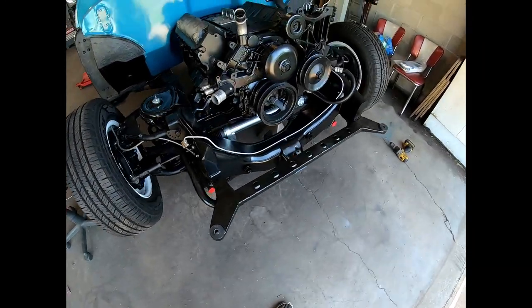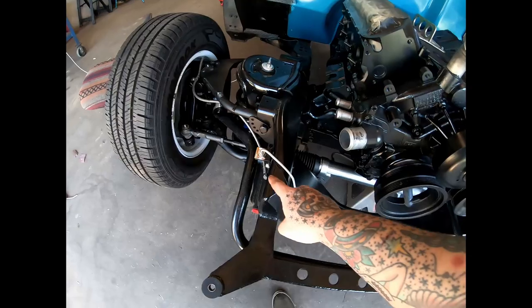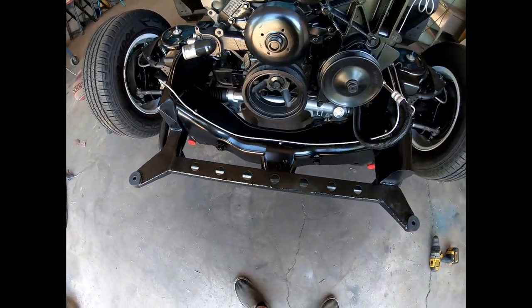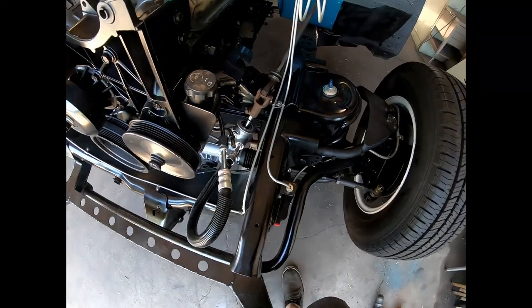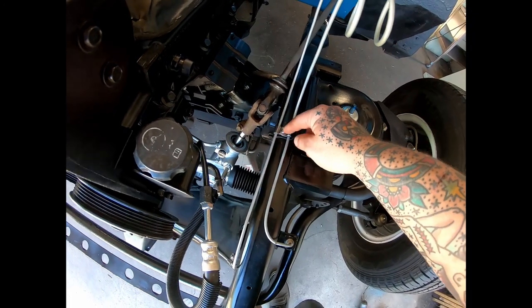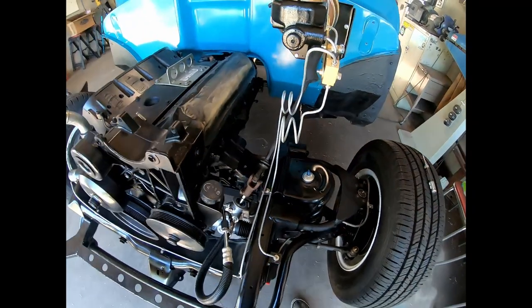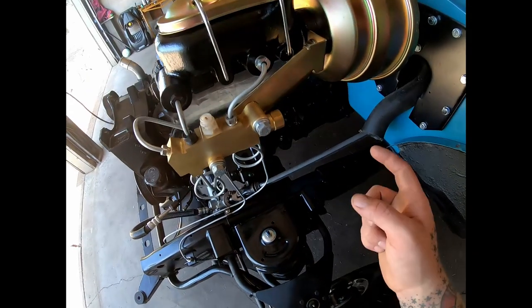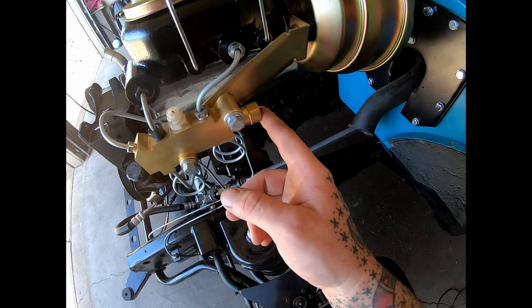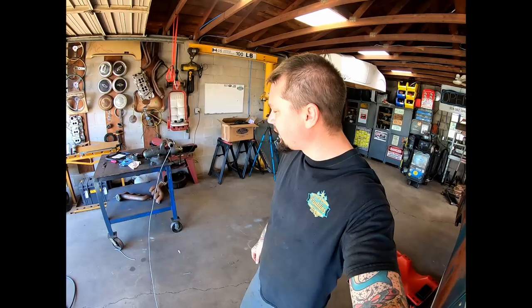Next morning now, and I got out here and I built the other brake line for the front for our passenger side. I started here and just threw a couple clamps along that cross member, kicked up over here, decided to share the same hole for this clamp. I had to bend the other clamp down a little bit in the vise to get it where it actually clamps. Come up with our couple coils there — overall I think it looks pretty good. Now we're going to do the rear brake line, which will come out of the rear of our proportioning valve. I'm not sure I actually have enough brake line to build this rear line — I kind of laid it out and if it does fit, it's going to be damn close.